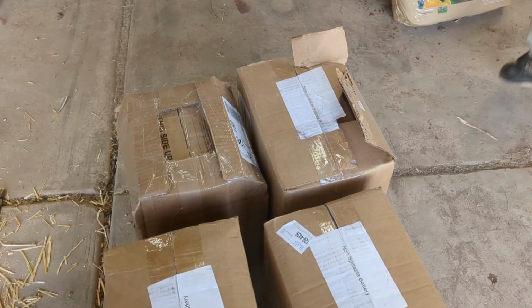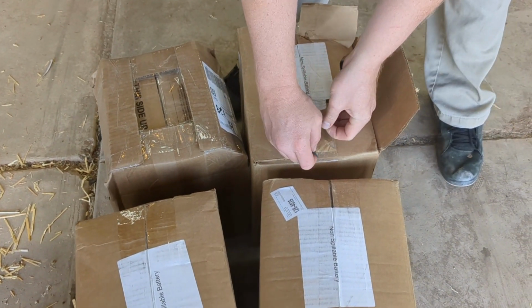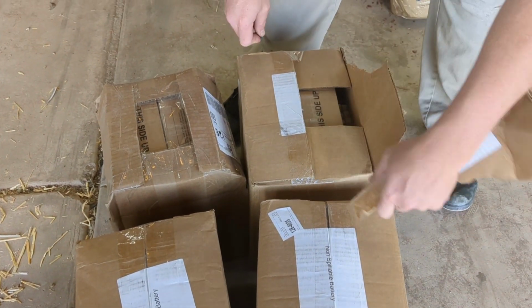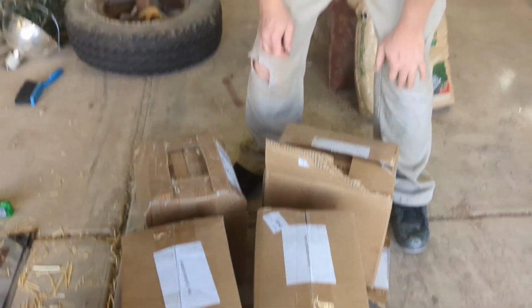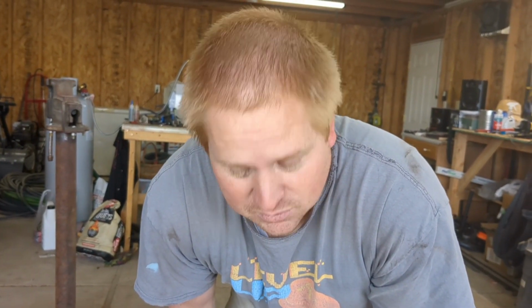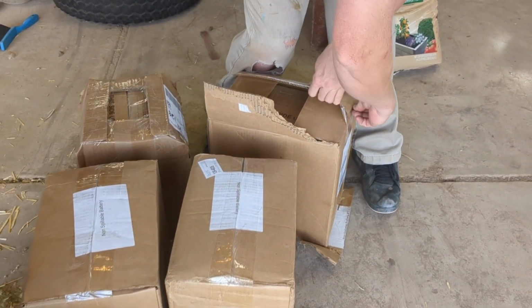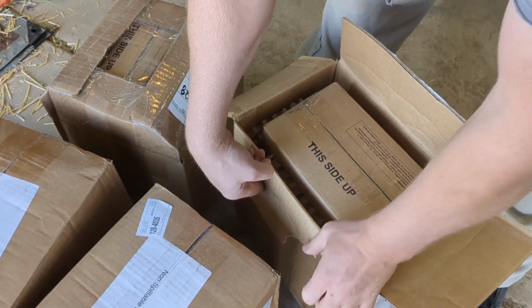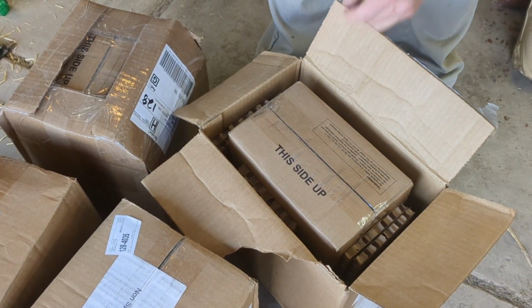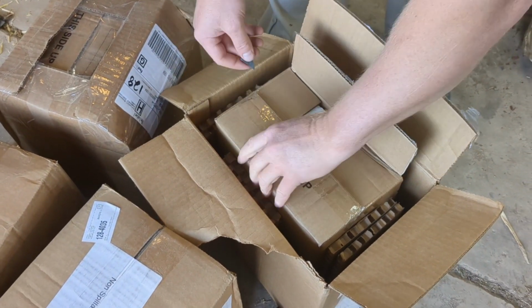Okay. All right, so these are the batteries that we ordered, and I'm doing this a little different because this is a 48-volt system, and normally it has, I think, 6 8-volt batteries is what they have, but those little 8-volt batteries are super, super expensive, so I decided to go with 4 deep cycle 12-volt batteries, and I think that will work fairly well.